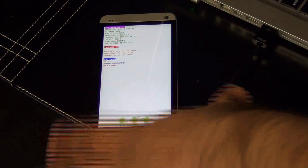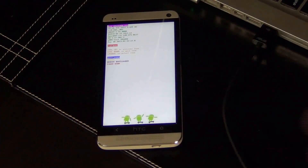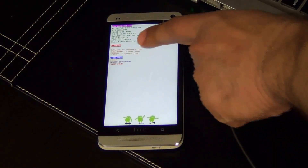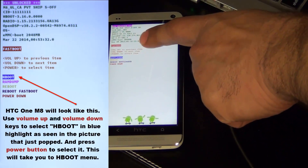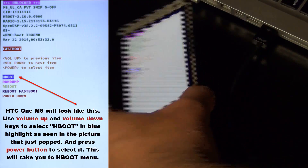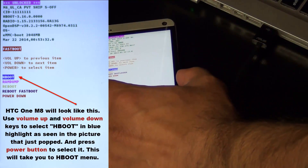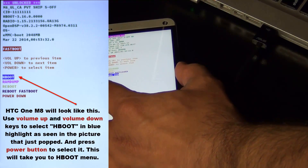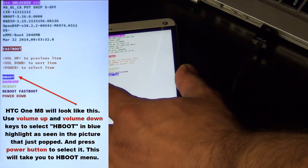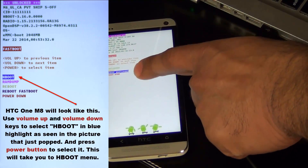Back on your phone, you're still going to be in this bootloader window. You can disconnect the phone from the computer — you don't need the computer anymore. We were left in fastboot mode. Use the Volume Up or Down keys to navigate the menu. Navigate to 'Reboot Bootloader' and press Power.